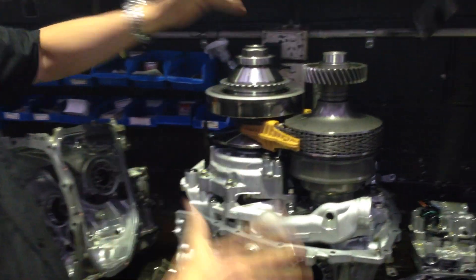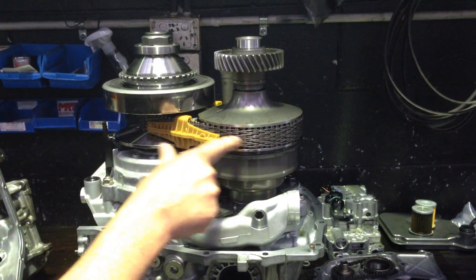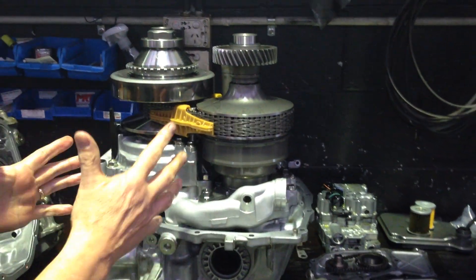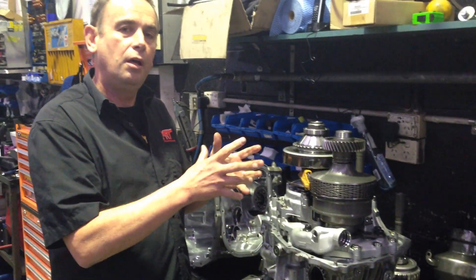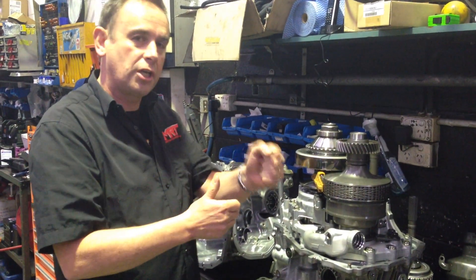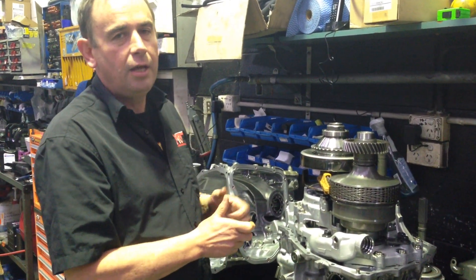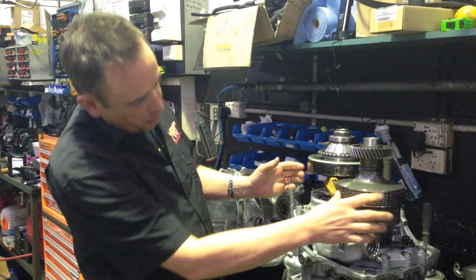The part I really want to show you is what the gearbox looks like itself, and this is the technology that is pretty cool, because this is the main drive mechanism — a really advanced belt drive between the input and the output shaft of the gearbox, which constantly changes ratio to keep the engine operating in its peak torque situation. So when you are accelerating with road speed, the engine stays at a constant speed, and the transmission changes ratio electronically on the go, without you actually having to change gears manually. You can put this gearbox in what they call manual mode and have it operate as a manual transmission, but for maximum fuel economy and performance, to keep it in its sweet spot for maximum torque, this is what changes.